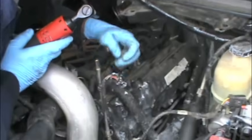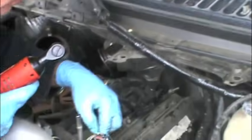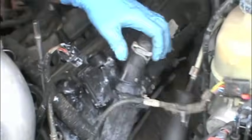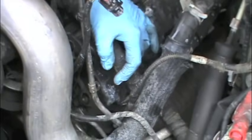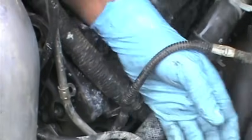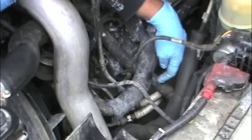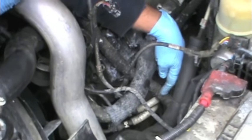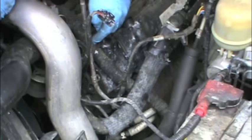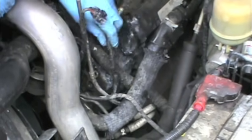Make sure you have just a regular bolt in there. It goes back in the top corner there. Two common places: one is that stud. The other one is this wire is not routed correctly. A lot of times your wire loom is mounted on this side and people will get it stuck underneath the air filter and the air filter rubs through it right here — another common place for causing stalling. So if you do have a stalling issue, look here for the stud, look here for the air filter rubbing on it. Those are the two common places for wire chafing.